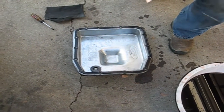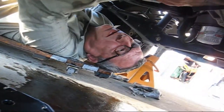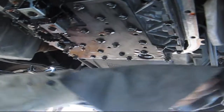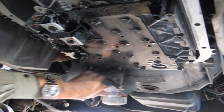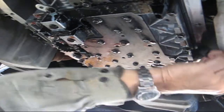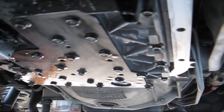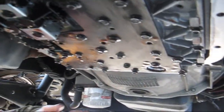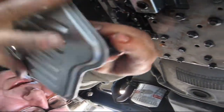So the next thing is let's put the filter back in there, bolt up the pan, and then we can put fluid in it. Let me clean all the way around — nice and clean there, perfect. Take a little automatic transmission fluid and rub it right on the filter O-ring. It goes right inside this hole — all we do is push it in and it snapped in. Voila, not hard at all.